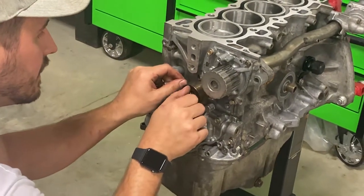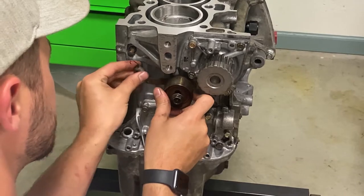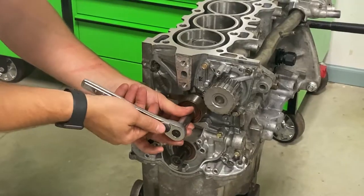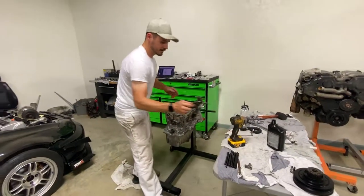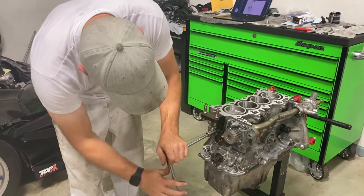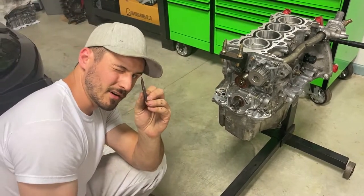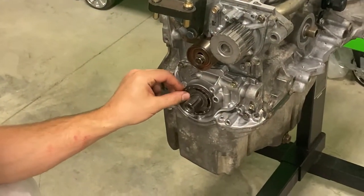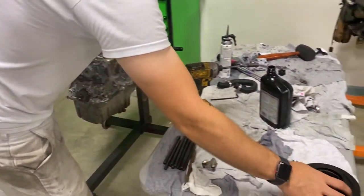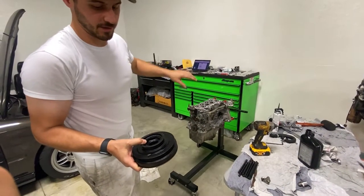This guy goes on this pin right here — go ahead and zip your bolt in. We won't tighten this down yet because you've got to be able to move it to get your timing belt tensioned. Small hook goes in the tensioner, big hook goes around the bolts. We'll throw the engine mount on. Next up, the timer pulley. When you put this on, it needs to go with the curved side facing the engine — it's kind of like a belt funnel. Then this pulley goes on. Then the crank pulley goes on with this keyway, but we can't put that on until we get the engine covers on first — so these will go on later.